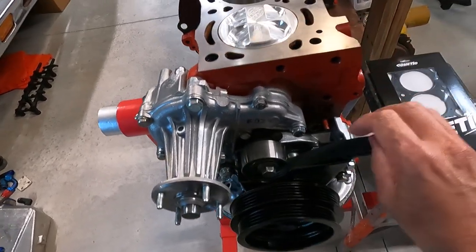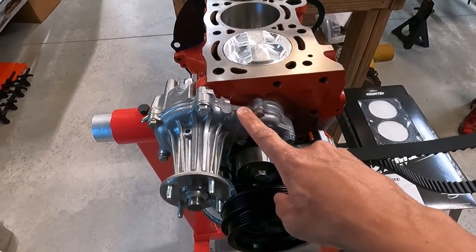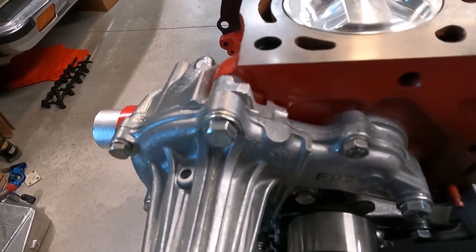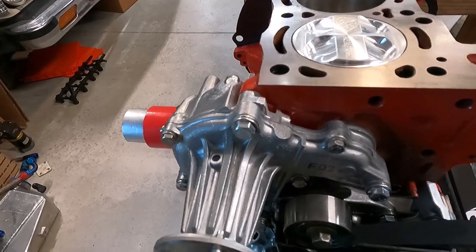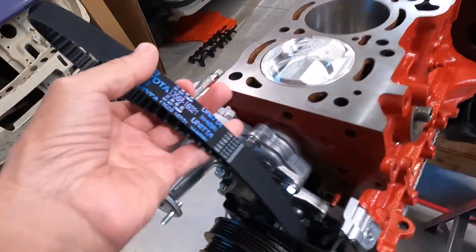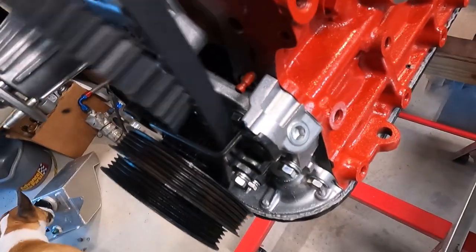Also, this water pump assembly came off of a 4AC, so I don't know if you guys have ever done something like that, but we actually cut this one little area off of here to clearance. I did see a video that somebody put up saying that's all you had to do, so we did all that. All stainless hardware here as well. Put all that in there. There's an original Toyota timing belt. I actually located and found the lower timing gear, brand new from Toyota as well.